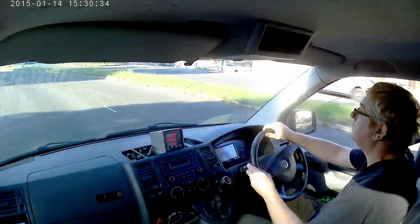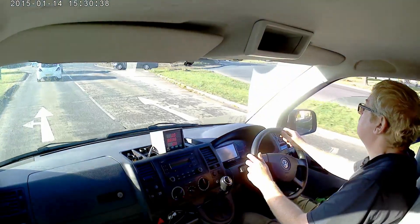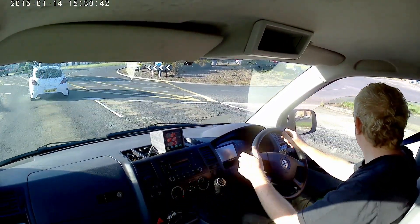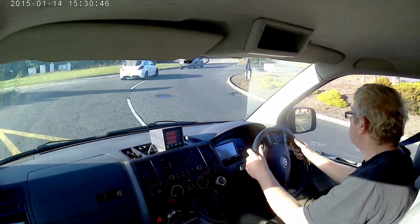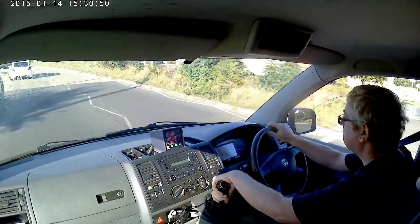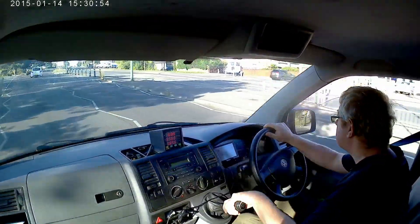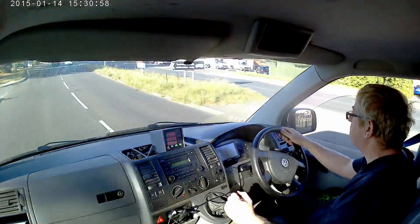I've been very lucky to find Scott Drive. This has been the biggest problem that I've had is the inverter — the bit that actually makes the electric van go. The inverter goes between the battery and the motor. I tried to do this with an open source inverter, but even with help it was beyond me, quite frankly.